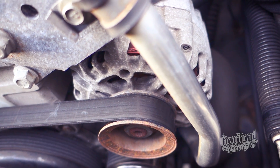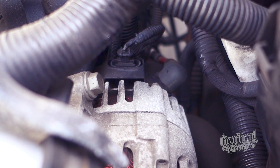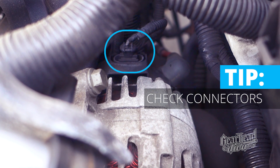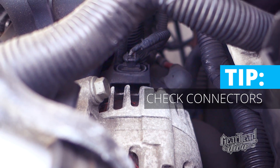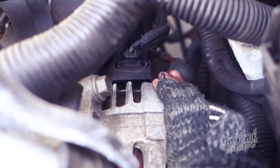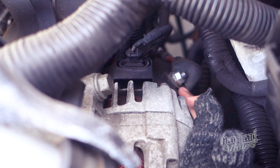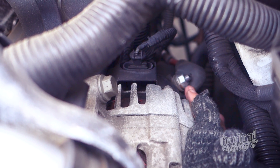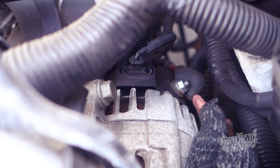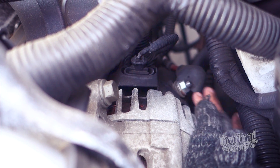Going from the front of the alternator to the back — which can be a little tricky depending on where your alternator is located — check all the electrical connections. Wiggle them about and make sure nothing is loose. Also check the main power wire coming off the alternator. Mine has a boot on it; push the boot back and you can see the main nut and post. Make sure none of this is excessively corroded — back off that nut, get it all cleaned up.